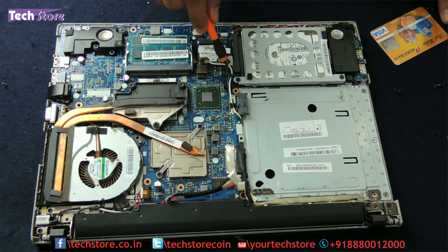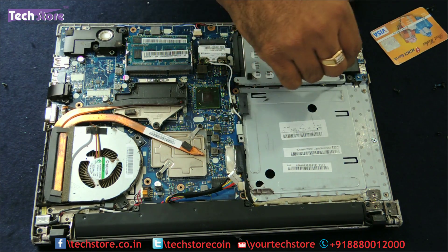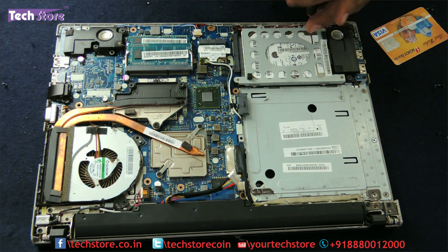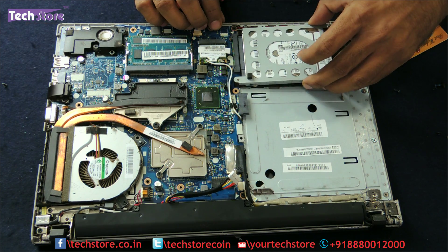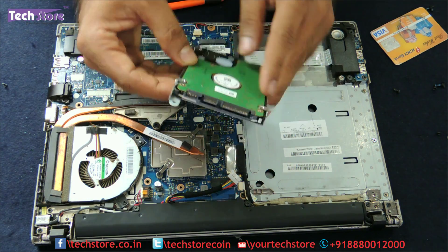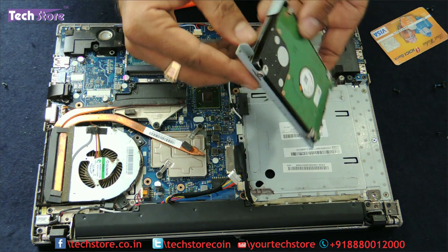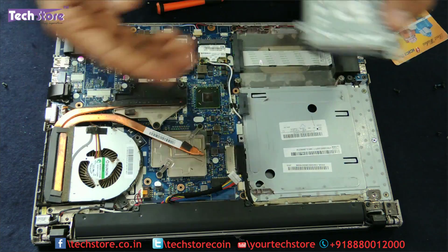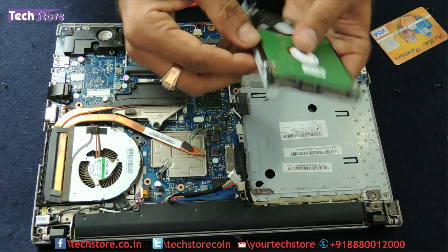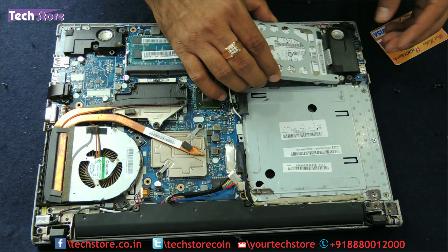For the hard drive, remove these four screws and the hard disk will come out. It is a SATA 2.5-inch laptop hard drive — slim or normal will be fine since the size is sufficient. You can upgrade up to one terabyte for this laptop. Take a similar hard drive, remove the two screws on each side of the bracket panel, transfer the panel to the new hard drive, and put it back.